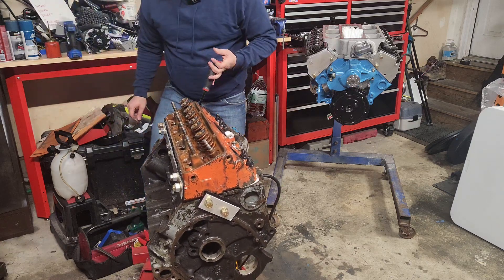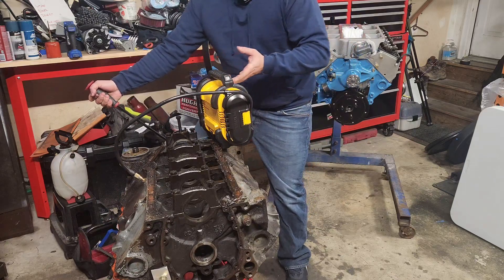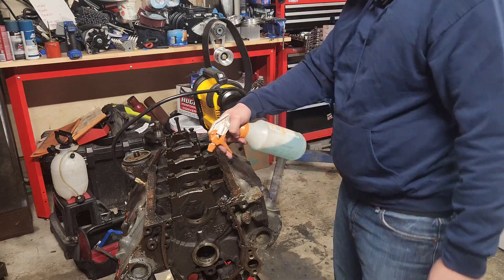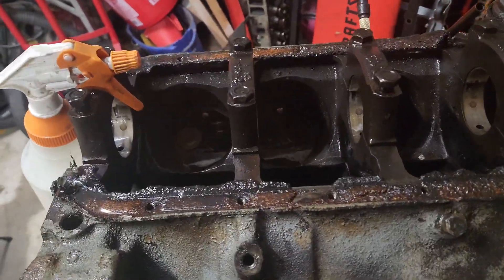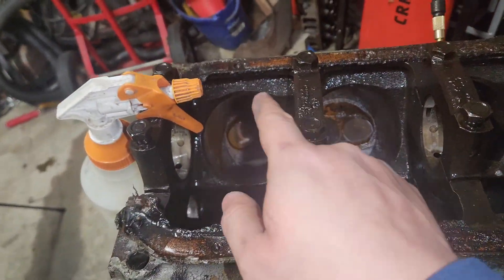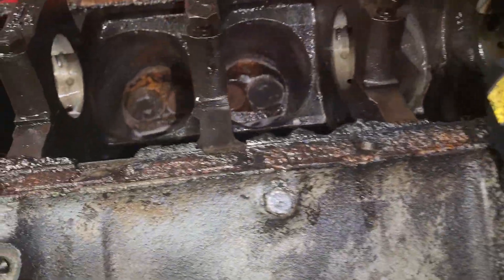That's a little tricky — you've got to turn the engine over and bring your air source too. Just manage it like that, don't let the engine go too far. I'm going to go ahead and spray some water in there and bring you over. It's a little dark in there — I have the technology. Benefits of recording with your phone. I soaked down all the cylinders and what we're looking for is big bubbles, like you're using a bubble wand. That'll indicate a crack in the cylinder wall itself. I don't see anything immediate, but I'm going to do this a few times just to be sure.